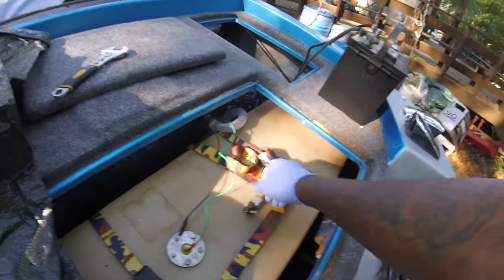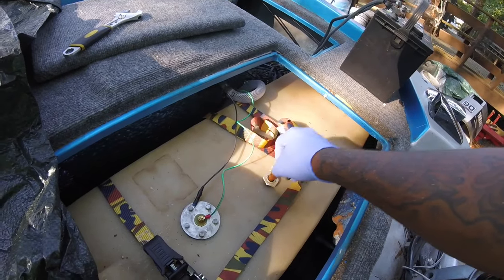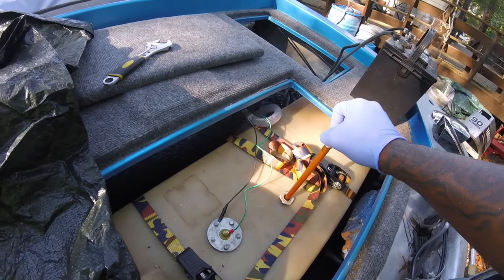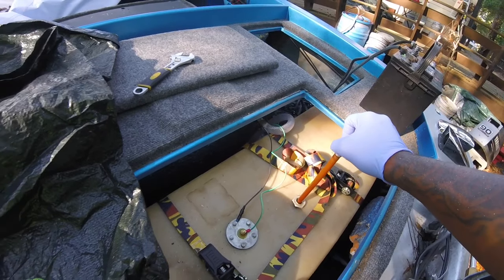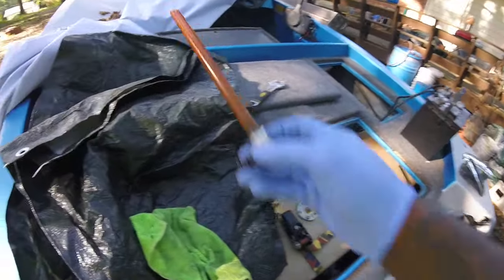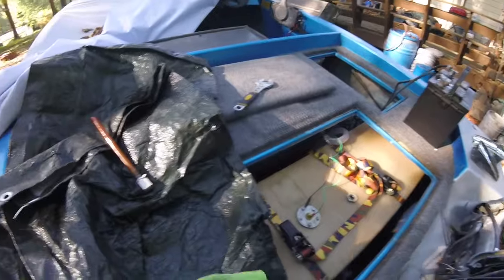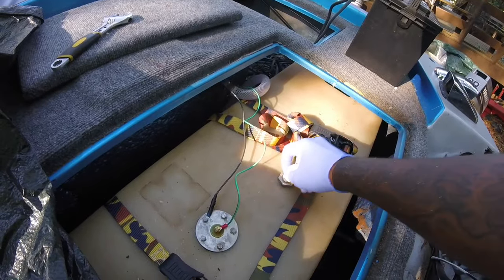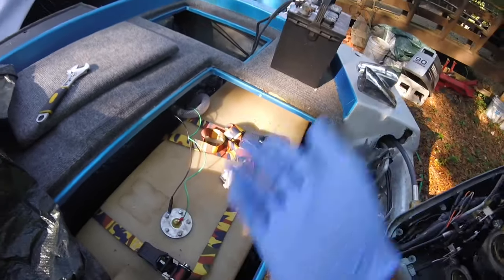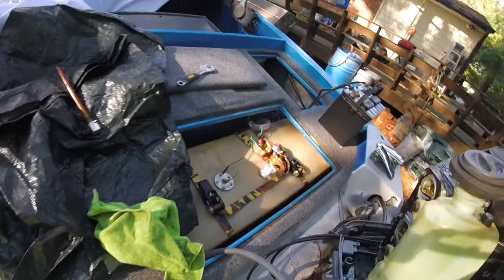Spares y'all the boredom of watching me take the disconnector loose, but I'm gonna take this off because I'm gonna need this to put inside of the one gallon with the seafoam in. I got that top right there because I didn't want to waste gas everywhere. Another thing, guys, when you're taking off your stuff like that, you might want to put a piece of simple paper towel or something that'll keep something from falling inside your gas tank while you have your quick connect off.